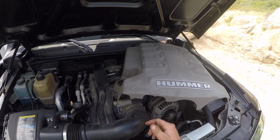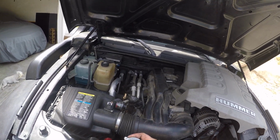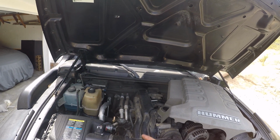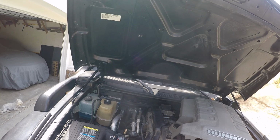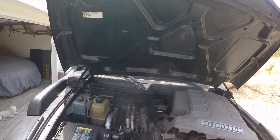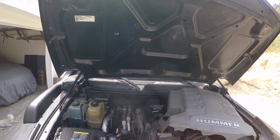Now, how much are we going to pump it to? There's some debate here, but the safe bet is this cap is rated to 13 psi. If your cap is 15 psi, then so be it. If your cap says something like 0.9, 1.0, or 1.1, that's in bar, and you'd use the internet to calculate how many psi that is.